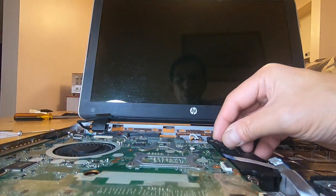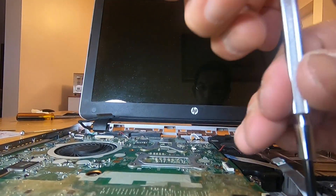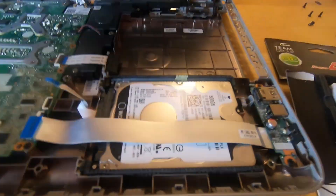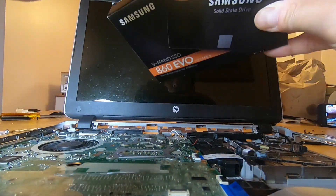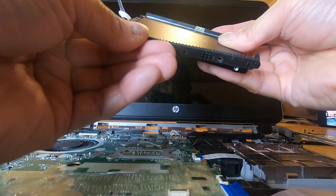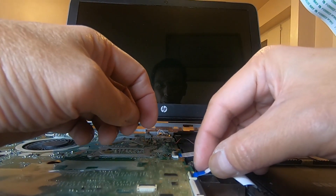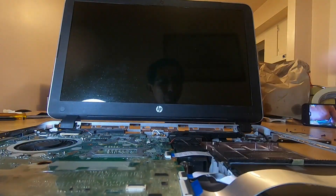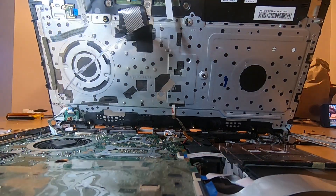Make sure you have all the screws and reconnect all wires that you removed — everything is a process in reverse as we reinstall everything. Be careful with the ZIF connectors and do not rush anything. Then we proceed to upgrade the hard disk drive with a solid state drive, which will make the laptop a lot faster when loading. Reconnect the rubber rails — a nice feature of this laptop — stick it in place, and reconnect the SATA cable.